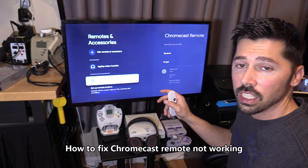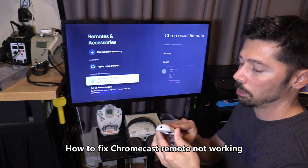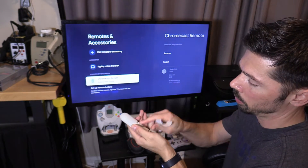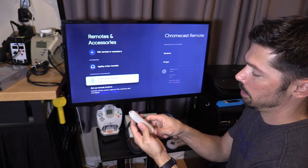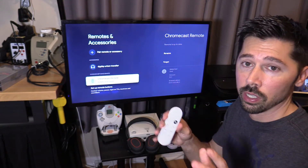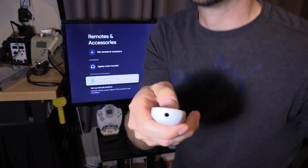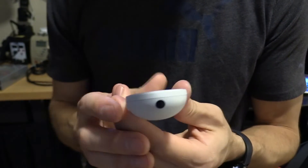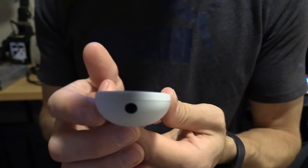If you're having a lot of issues with your Google Chromecast remote — it's not working, or sometimes it works and sometimes it doesn't — simply remove the batteries for about 30 seconds, make sure they're facing the correct way (they both face up), and see if that fixes the issue. If it doesn't, put fresh batteries in, as low batteries can cause weird issues. If you dropped your remote, you may have a defective sensor. To check it, use a digital camera on your phone — you can actually see the infrared sensor activate when you hit volume up and down. The human eye can't see infrared, only a digital camera can. If the light looks very dim, swap out the batteries.